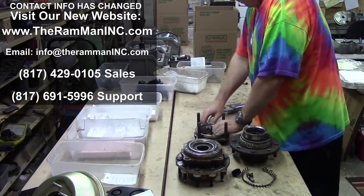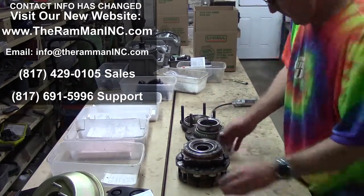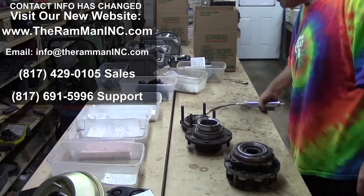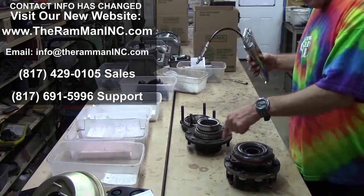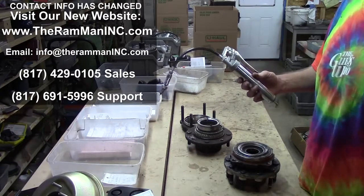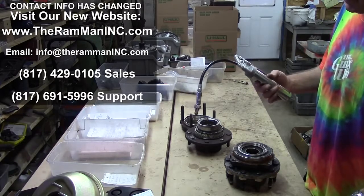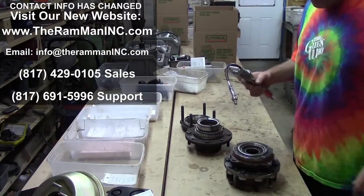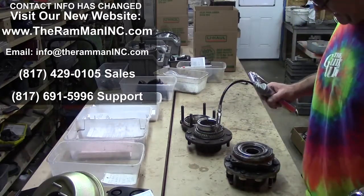There goes our molybdenum grease. We found that oftentimes these bigger hubs will eat an entire three-ounce can. And when the hub is new and it comes in the box, oftentimes we'll find that it'll eat an ounce or two — especially that lower-end stuff. Now stuff like your Timken, top of the line, considered the best there is, they do a good job. So it makes you wonder, after they put it together, how much grease they're actually putting in these things.